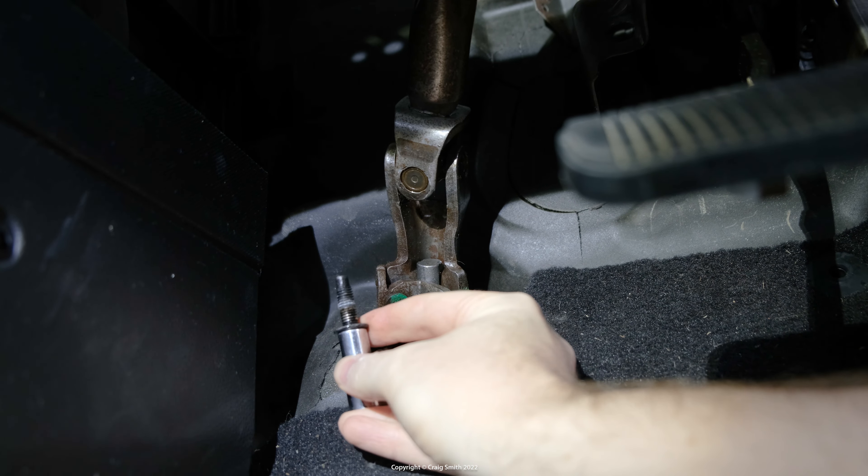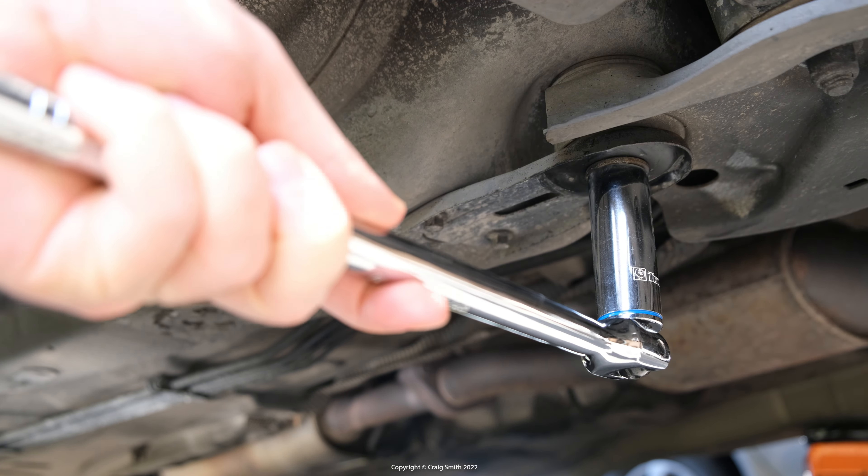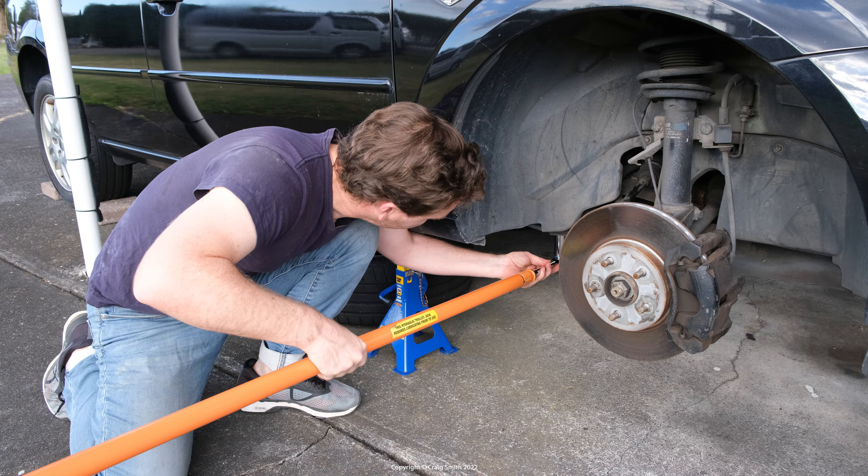To lower the whole front subframe you'll need to work the big 21mm bolts in all four corners. This is one of the rear ones — they go straight up through the big bushing into the chassis. I sprayed these with penetrating oil a few days before trying to turn them, because online you'll find many tales of these bolts being seized, and efforts to turn them instead ripping apart the threaded section inside the car — after which they'll just turn forever and you'll have to cut into the car from the top. My jack handle makes a nice cheat bar — slightly ridiculous but it works.